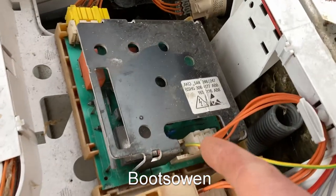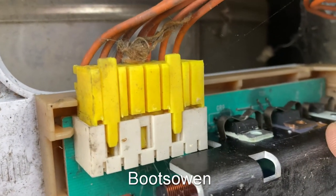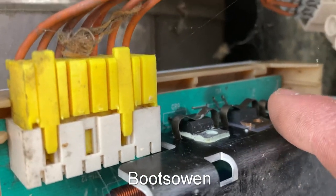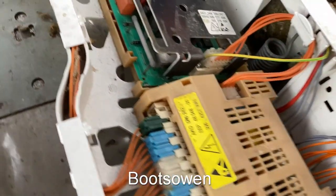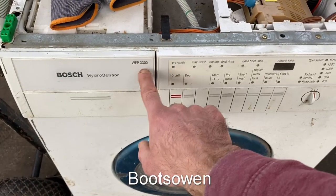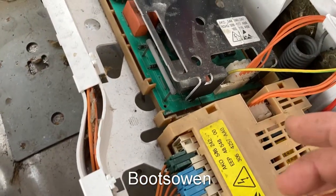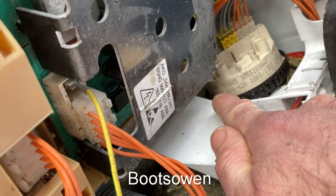There's a problem with that motor control board and I really do not want that to get damaged. There's a huge heat sink on top and there are some little components there. The one in the center doesn't look like it's got much heat proofing on it. Transistor one — I'd say that is GR9 or 14. If anybody has a wiring diagram for this machine or for any of these Bosch WFF, WFP, WFK, I'd be interested to see them because these are the machines that I really like. I looked at it before and I found a number on this of 99.